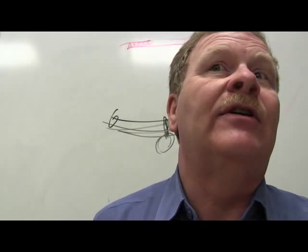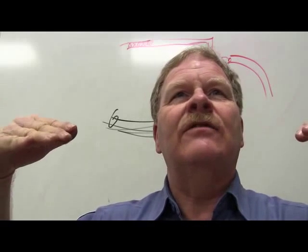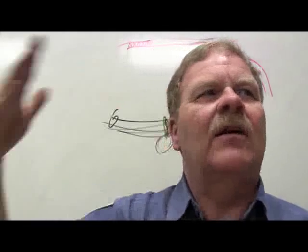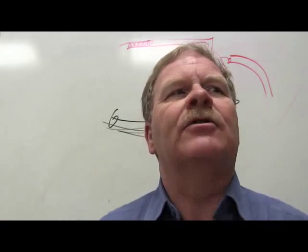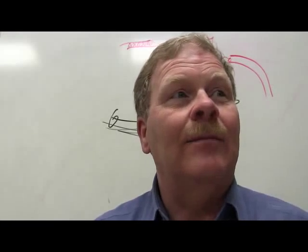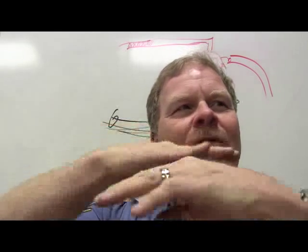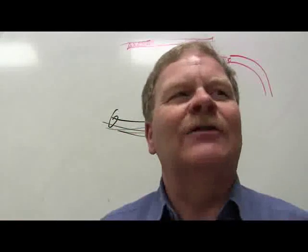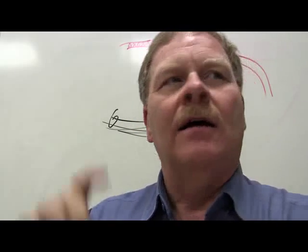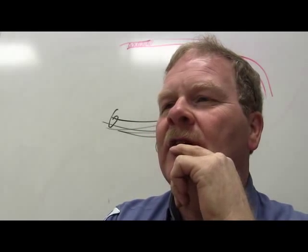The reason the tie bolt sheared was that when reassembling the leaf springs he had used a regular bolt instead of the proper hardened tie bolt, which didn't resist shearing enough. A tie bolt is harder than a regular bolt so this problem doesn't usually occur, but this incident illustrates what the thrust line concept is about.